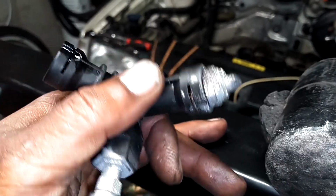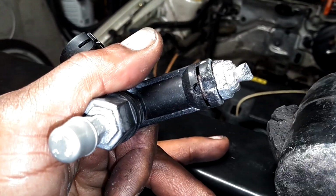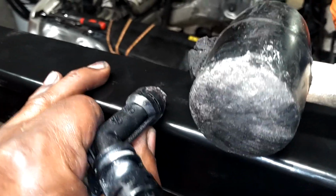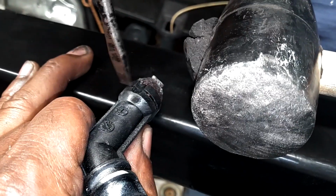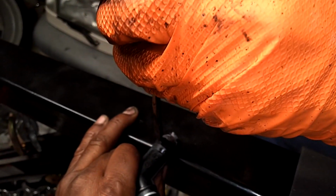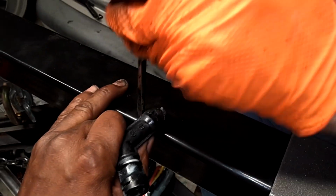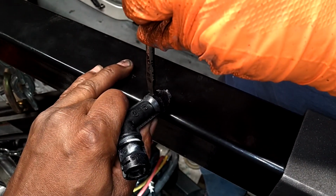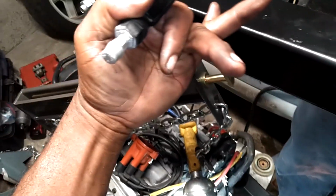We have this clip stuck in where the hydraulic line came in. He had to go to the salvage yard to get another line. Can't get this clip out. We're going to turn it upside down and try to tap it down through there with this mallet. Go ahead, set it on there on one side in the little slit. Tap that with that hammer and see if it starts going down. All right, tap the other side. There we go. It's coming out.